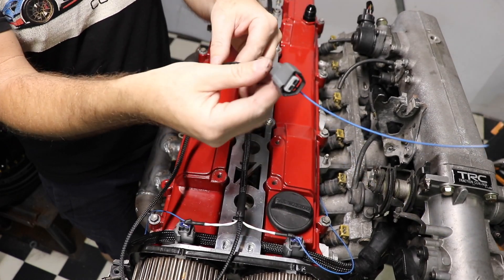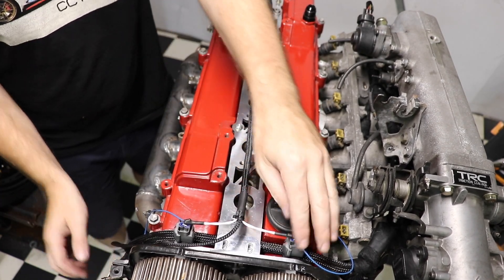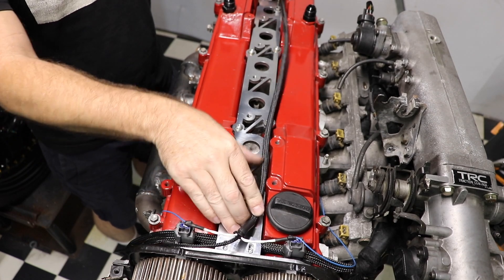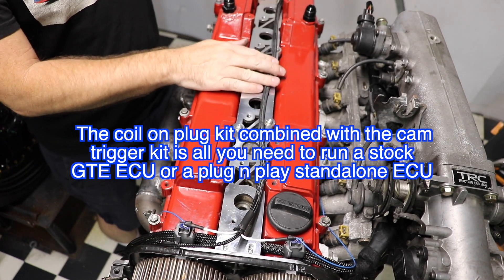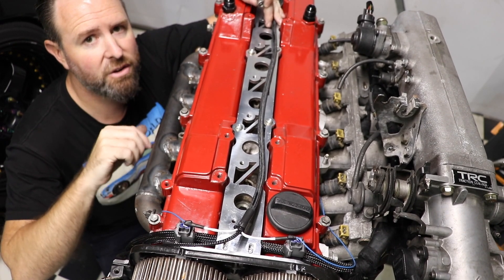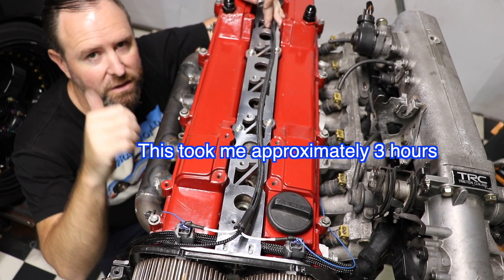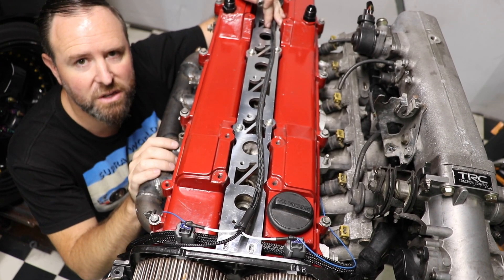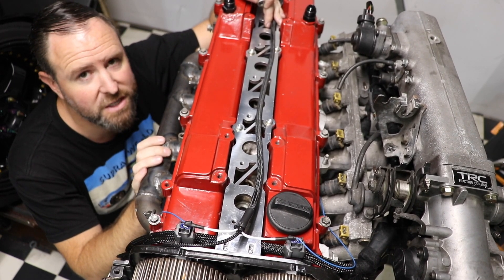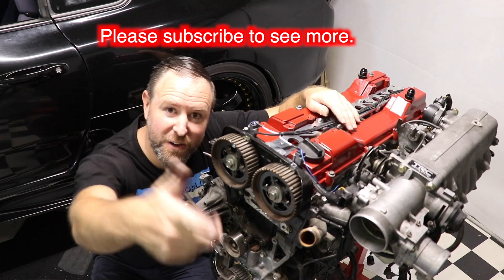This one is for the crank sensor, so all this is plug and play — it runs down the side to the crank sensor and combines with the coil-on-plug harness. Run those through the firewall and you've completed your GE to GTE loom conversion. You can start the car on a GTE ECU or a standalone plug-and-play ECU and it will drive away — without spending a thousand dollars on a new engine loom. So folks, thank you so much for watching. My name is Clayton Carlill, this is Supra Review World, and I'll see you in the next video.